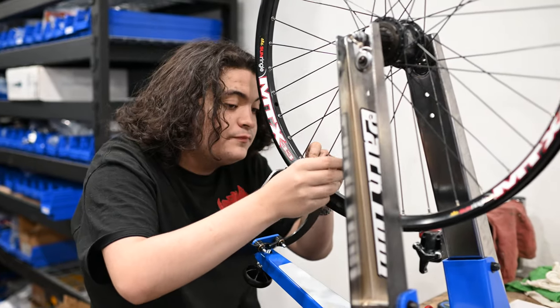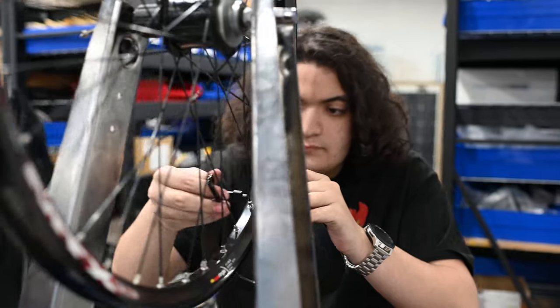Along with the larger wheels, we take the Eco24 from the EcoTad's stock 7-speed gearing and turn it into a 24-speed by upgrading it to an 8-speed cassette and combining it with the Sturmey Archer CS RK3 Hub. The Sturmey Hub features a 178% gear range, which is about the same as what you would get from a triple crank set. Like traditional front gearing, we have a three-speed shifter, but instead of a front derailleur, the three gears are built into the hub. A main advantage of the geared hub is that it can be shifted while stopped or coasting, while a triple crank set requires the rider to pedal while shifting.